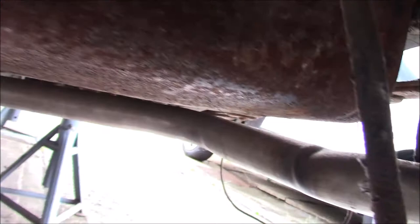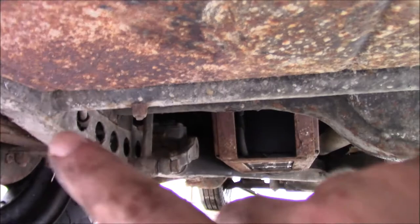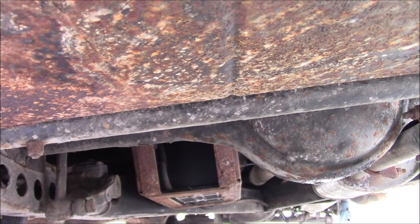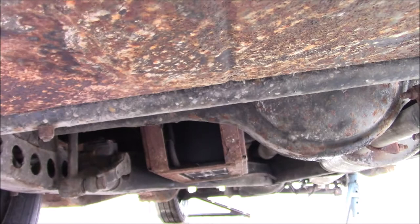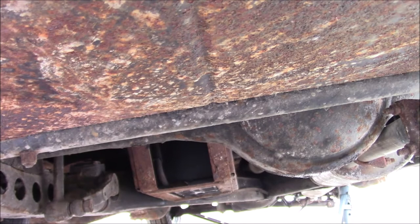Thankfully the tank's fairly easy to remove — there's just two bolts. You have a bolt there and one in a similar location on that side which I can't show you because the exhaust's in the way. So I'm going to undo those, and then I should be able to wiggle this out and drop it out of the car, and then I should be able to get access to the wiring. This is what's been taking so long with this job — it's figuring out where things go, how things are supposed to fit, and what you need to take apart to do it, because the wiring's one of the first things to go in the car.